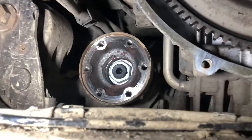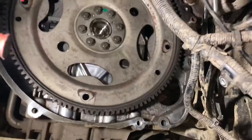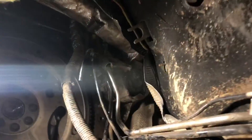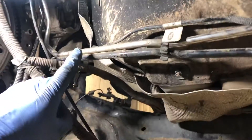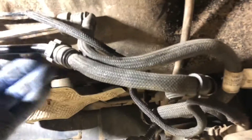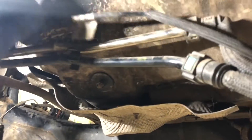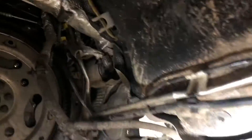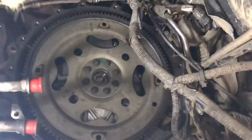That's the flange - the drive flange for the front diff. So this being a 3-litre, this has got some fuel pipes. It's obviously a gearbox-out situation. These fuel pipes were clipped on the side of the gearbox. This pipe here is our fuel pipe for the fuel burning heater. This pipe and this pipe are both breathers for the gearbox and the transfer box. And all this wiring loom that I've tucked out of the way - that's the wiring loom for the gearbox and transfer box as well.